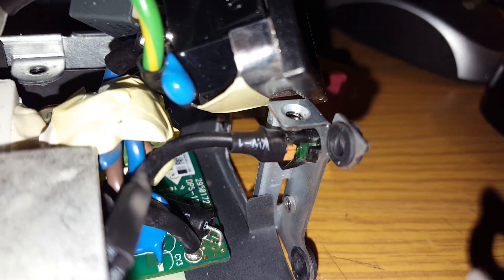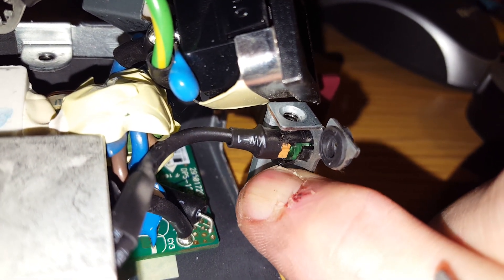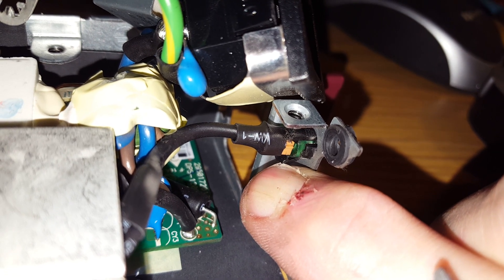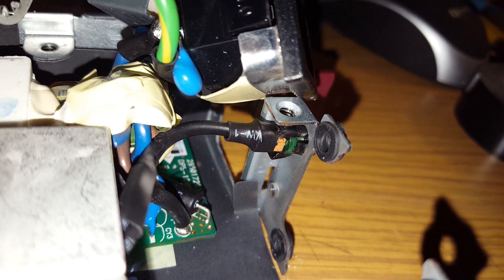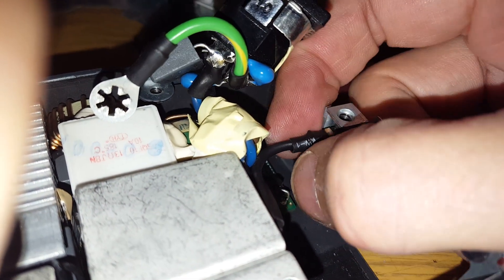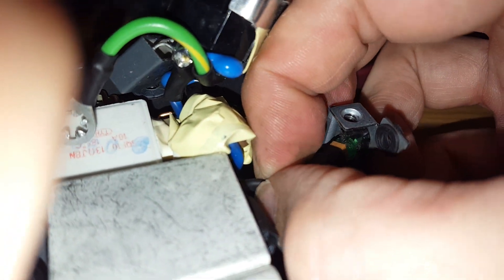This comes up and can just flop out of the way. The next bit is a little difficult — you can see you kind of push this down. There are two little clasps on either side of that LED; you need to push that down and then the whole thing will just pop out. Now you don't want to yank on this connection because it's not very secure — just push it as best you can until it's ready to let go and then pull it out of the way.